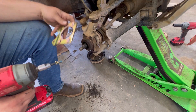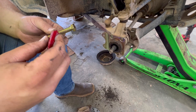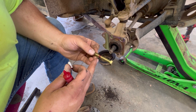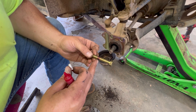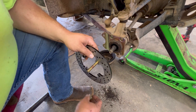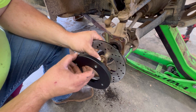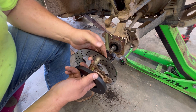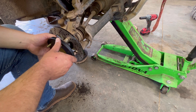So putting this plate on, these two holes face the rear. The caliper does go on the back side of this. I'm going on with some blue Loctite onto these bolts. I'm putting a smidgen of red Loctite right here because back here nothing screws in, and up here is where your lug nut screws in — this spot right here is where it's screwing into that spacer. The way this gets assembled is you take your rotor, put your bolt through, install a spacer, then the hub. Then this will get screwed into this spacer here. Assemble all four studs onto this, and it says fully tighten them. Here's what your fully assembled product will look like, and then it says go ahead and reinstall your hub back onto the axle.